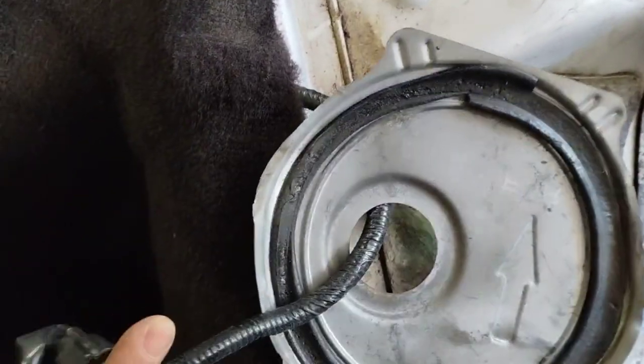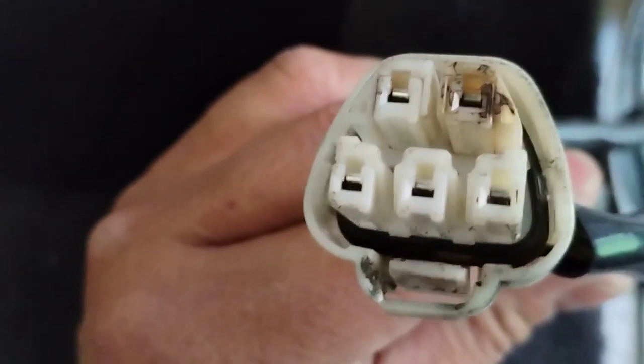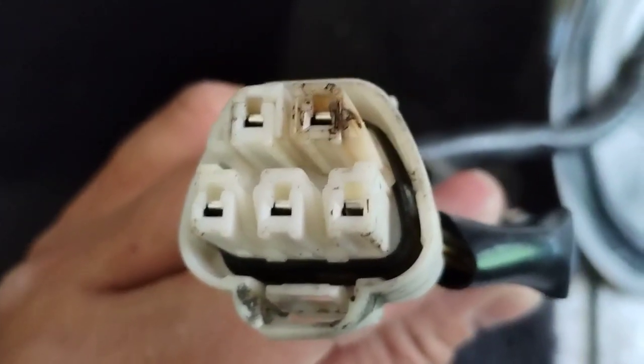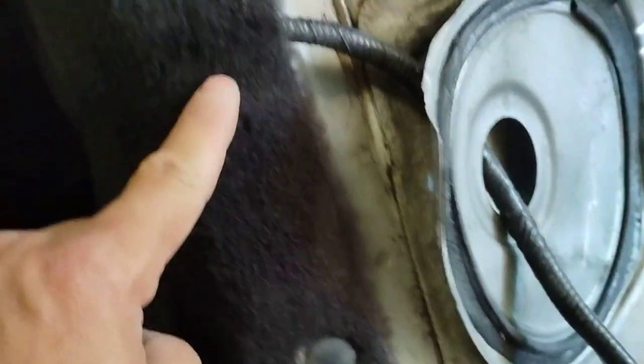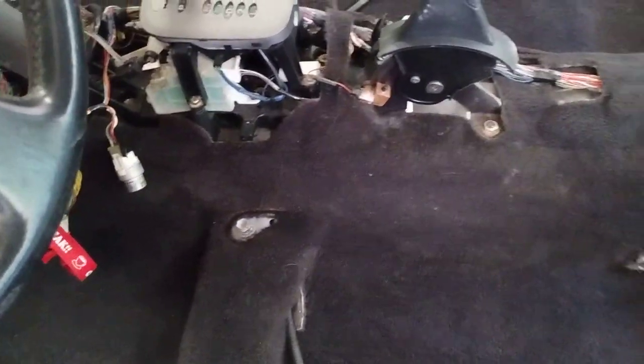Okay. Alright, so the harness looks like this. Ooh, I see a little bit of stuff there. Yeah, I'm not worried about that because it is those three harnesses. Towards the bottom is the fuel level sensor. Okay, so inspect the wiring is good, and you can see the wiring comes along here, runs along the floor, runs through here, and it goes to the body control computer.